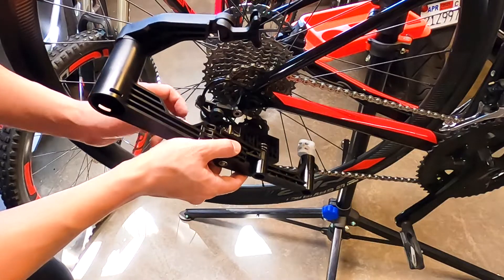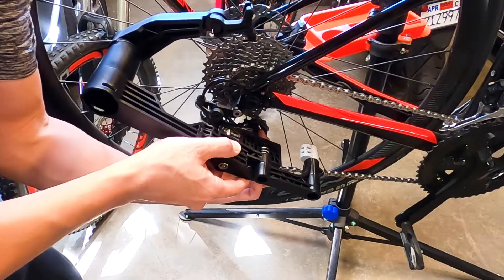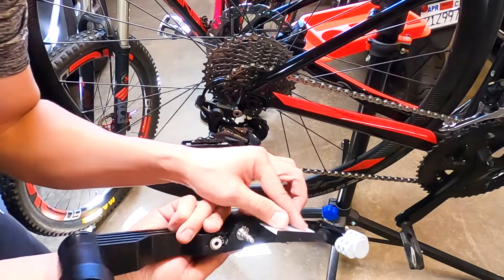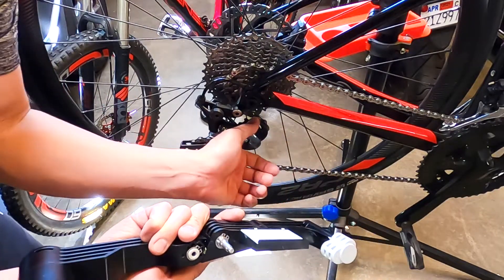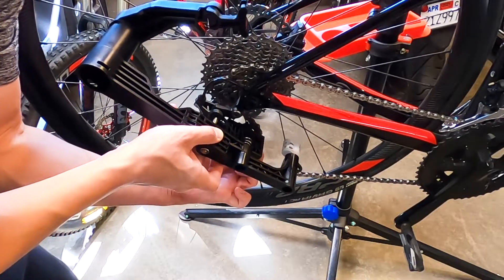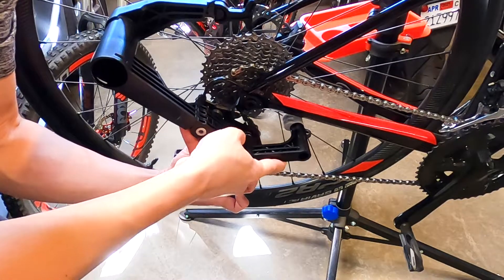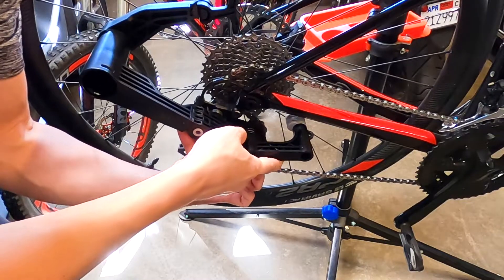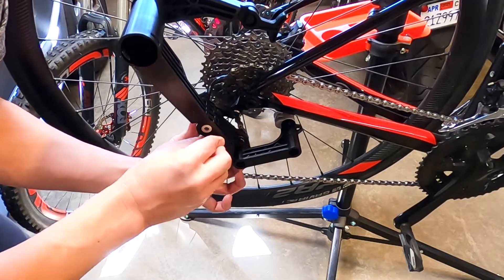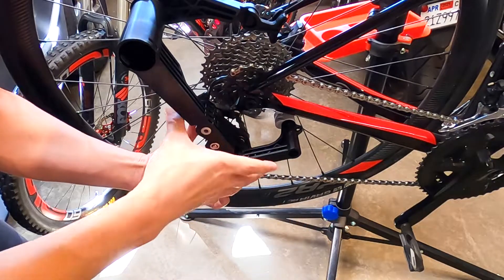I'm using the shorter pin. I'm holding the derailleur with my left hand, pulling it down just slightly so I can slide the derailleur pad — I'm calling it a pad because it has something here that won't scratch your derailleur. So the pin lines up with there. Hold it down, slide it on. Then while you're holding it down with your index finger, you can clip it there — you can hear it click. And then you keep pulling it back to secure it. Make sure always that the pin is straight and not angled in any way.